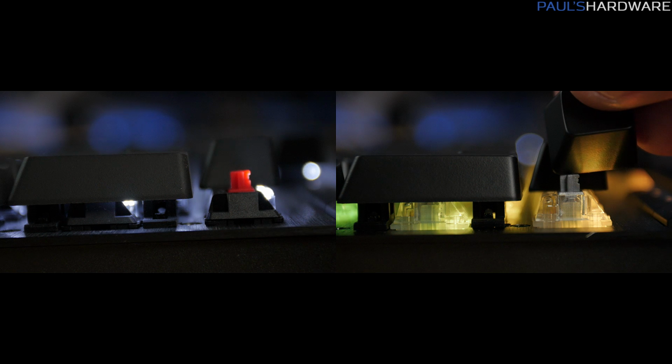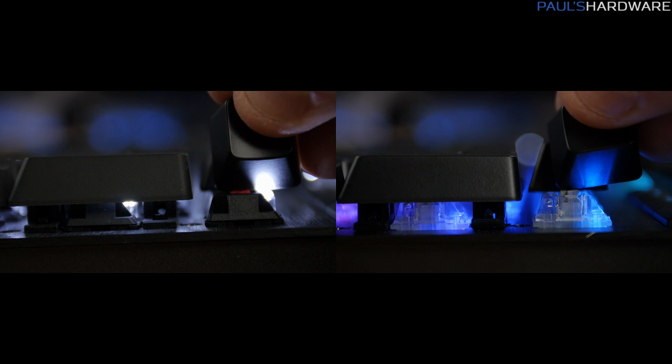As for the speediness of the switch, remember that most mechanical switches actuate and send the keystroke to the system well before the key actually bottoms out. So if you pressed both keys at the exact same time, the MX Speed switch would register the keystroke after the key has moved 1.2mm, and the MX Red would register the keystroke after moving 2mm down. It's difficult to nail down precisely how much faster it is without some high-speed camera work, but Corsair's 40% faster explanation, while being based on math, is definitely dripping with at least a little bit of marketing hyperbole.